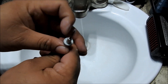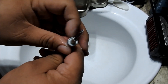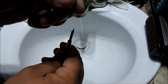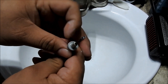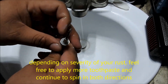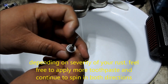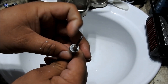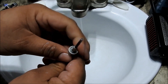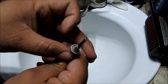What the toothpaste is actually doing is the grit — there's actually grit inside of the toothpaste. That's polishing away all of that rust, all of the surfaces that the bearing balls are making contact with the races — this is removing that rust. If you ever see anybody paint a car or get a car ready for prep, they'll put down the primer, get some sandpaper and sand it down — wet sand it to get the surface nice and smooth. That's what we're pretty much doing with this toothpaste. We're wet sanding the races.